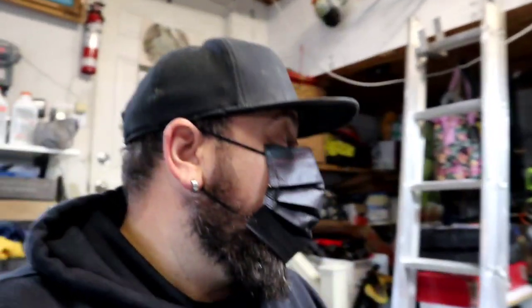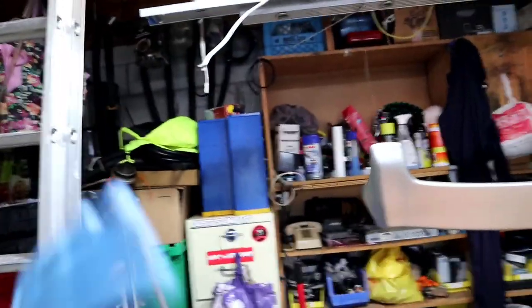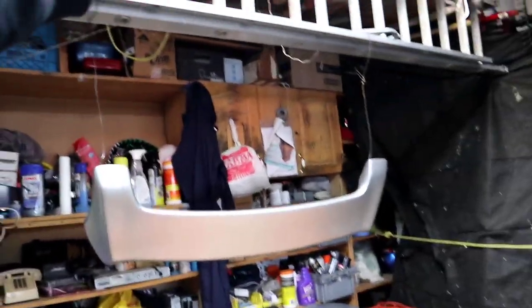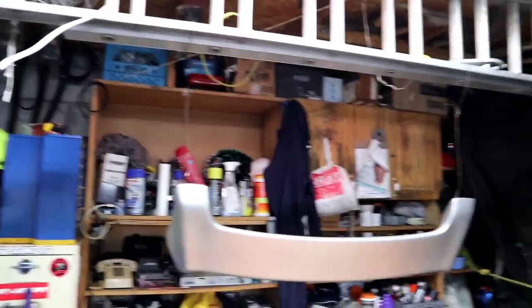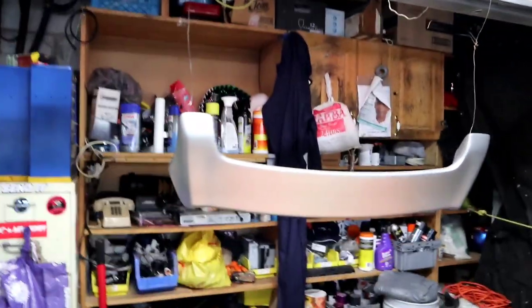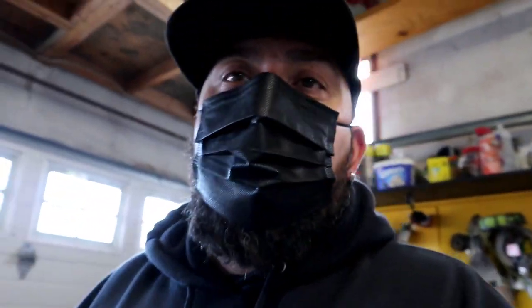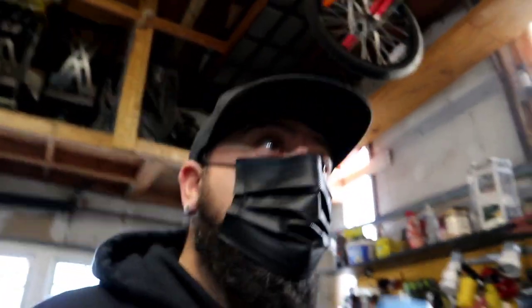I already gave the final coat of paint. I have the clear coat in my pocket staying warm. I've got to give it 10 minutes before I can start applying clear coat. I gave it even coats and the silver is starting to look really good. It's a bit dark in this area — I should put a strip of LED lights like Chris did in his garage. The wing took the paint very well and I've got the heater going. I'll move it to a higher step to blast heat towards the wing once we're done clear coating, then let it sit and cure.